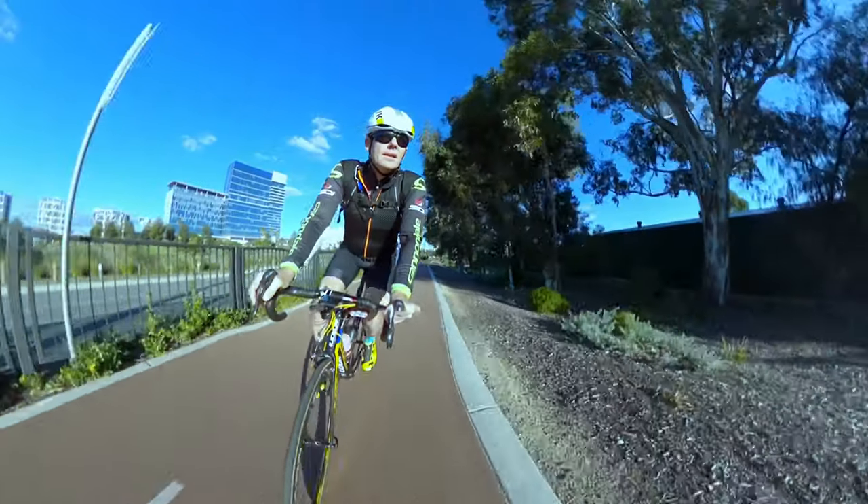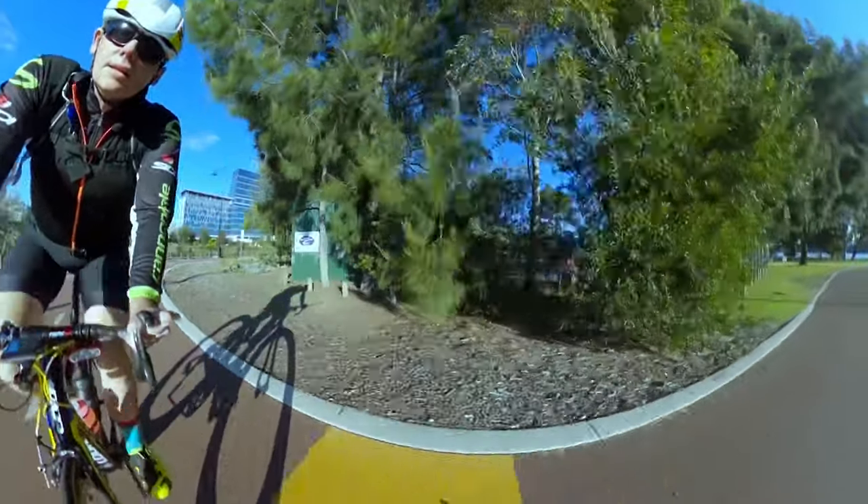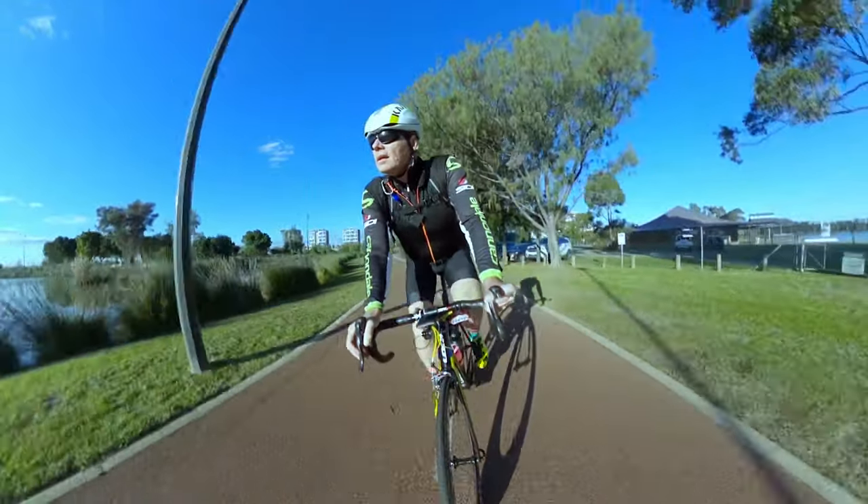In general, from my interaction with other cyclists, and even myself before I wised up, people tend to run their tyres at too high a pressure. What this can cause is a harsher ride and also premature tyre failure, because you're putting a lot more stress on the tyre, especially with the wider tyres pumped up to too high a PSI. They just can't handle it.